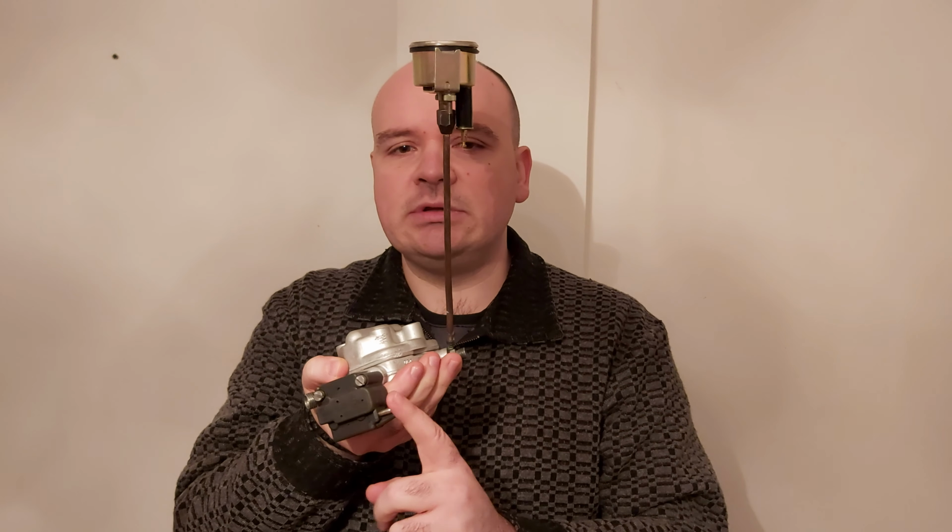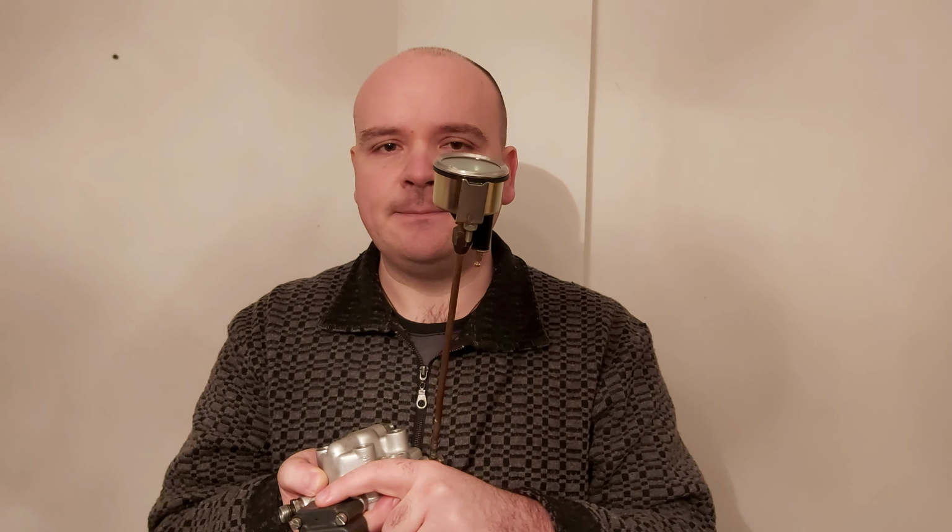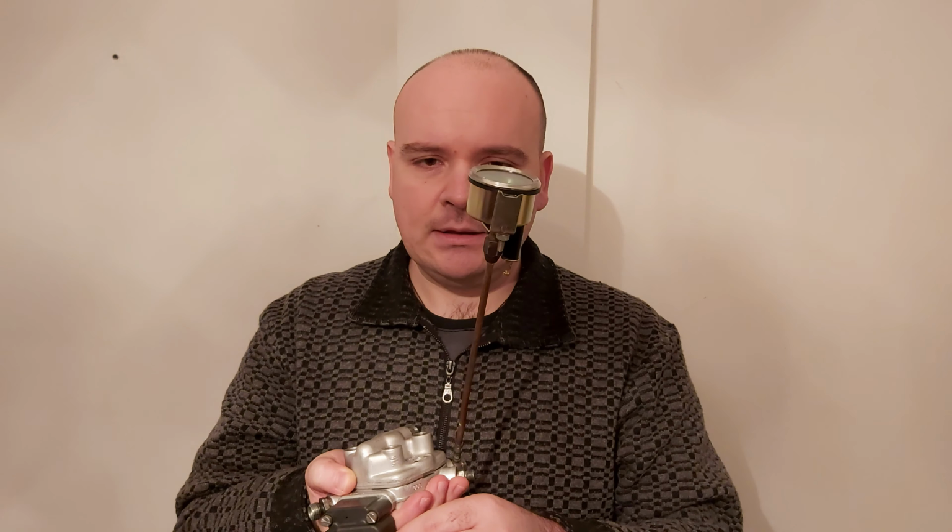Well, some people say that before starting the engine, you should disconnect the EHA. As you disconnect the EHA valve, then you start your car and you watch at the gauge. The target you want to get is between 5.3 and 5.5 bars. For six-cylinder engines, between 5.7 and 5.9.